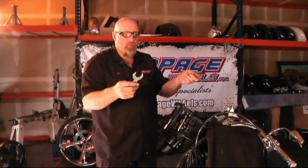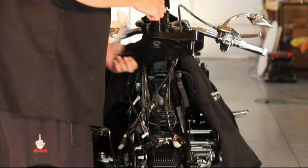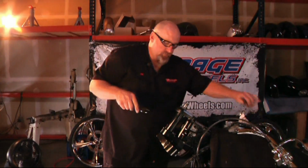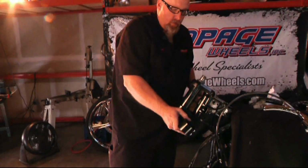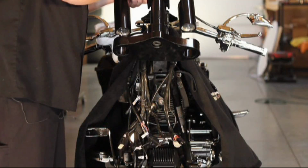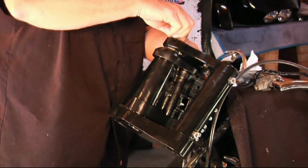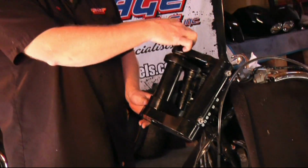Get a wrench, and then use a crescent wrench or anything for the top nut to get this on. Make sure you break in the grease. Then you've got your top locking nut on, and go ahead and lock these together. There, your lower tree is on. Once again, you already had your upper tree assembly there. Stick that assembly on with your washer and the top nut. Basically, at this point, we just leave the top nut a little bit loose while we get the forks installed into the bike.